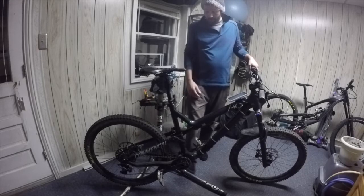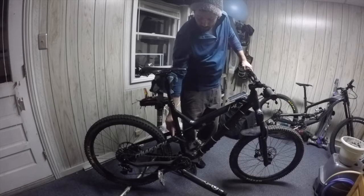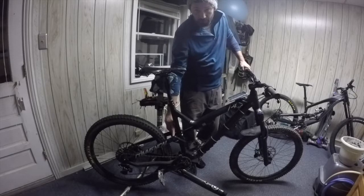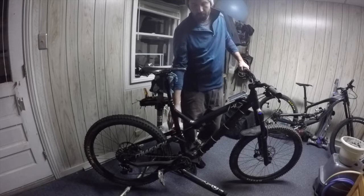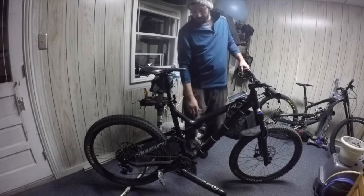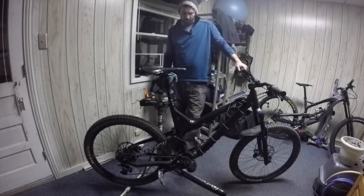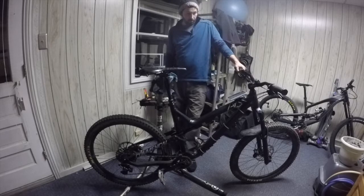So that's pretty nice. I had a first time at the bike park. I did have some issues with the bolts loosening for the suspension. Not really a big deal. Tighten them up. I think I finally took them out, cleaned them, retightened them with a torque wrench to spec, and they've been solid ever since. I want to say that happened maybe 2 or 3 times. And then just taking them all the way out, cleaning them up, new Loctite, throwing them back in there, and good to go. So that's my bike check.